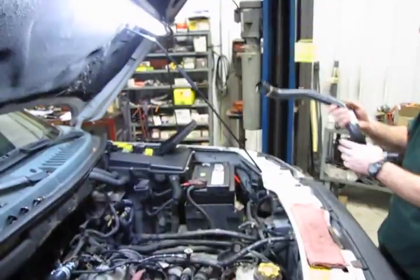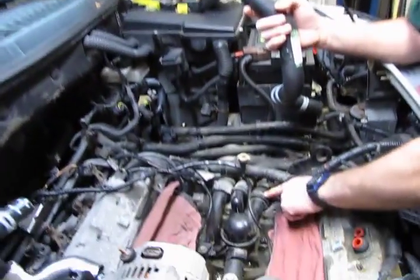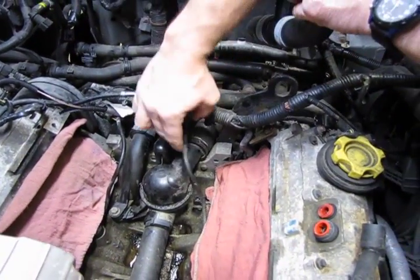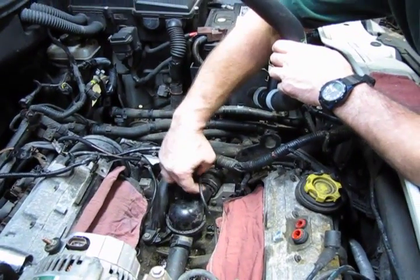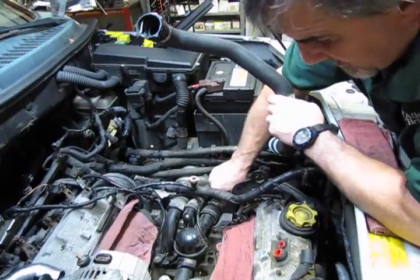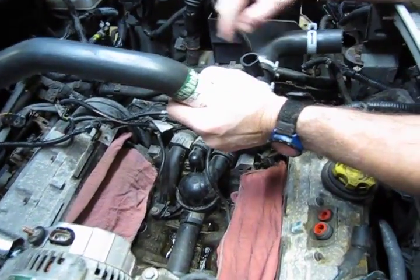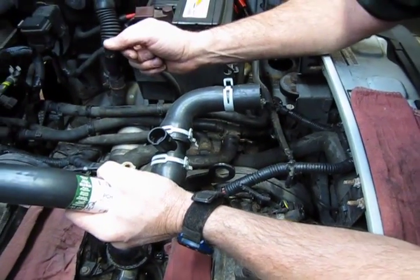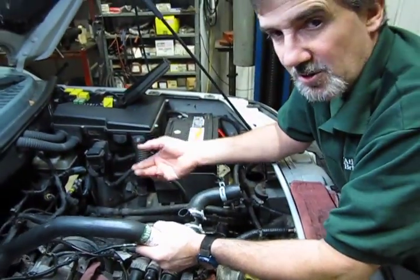You have this lower hose that attaches here. This is the same where you'll pull the clip up, give it a wiggle. Sometimes you just can take a small piece of wood or small mallet and just tap that off, because initially they don't come off easy. They kind of freeze in place. You'll tap that off, and then you'll notice towards the bottom there is a sensor installed. Just unplug the sensor when you're pulling the hose out, and worry about getting the sensor out once you've got the old hose up in place.